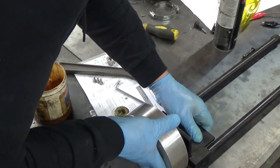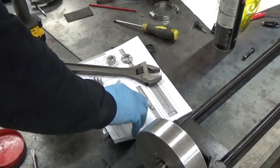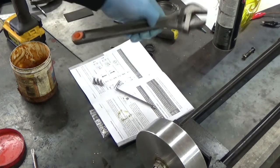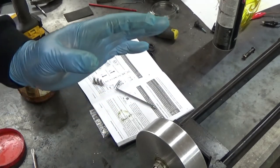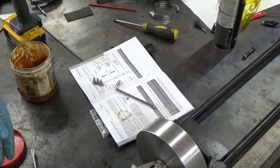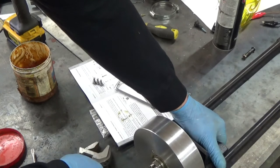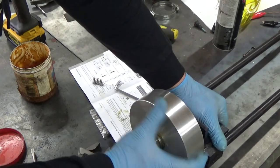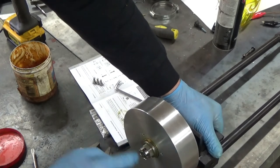I made this shaft so I know what it can do. The other bearing is pre-packed. Buying a greasing machine and then going through the painstaking task of keeping it clean is beyond it. Usually I use a pair of channel lock pliers to adjust these, but today I'll use a pair of crescent wrenches. What you do is tighten the bearing up until it nips — you can feel the taper come together, and when it's tight there's nothing left. Then you spin your wheel, which evacuates any excessive grease. You can feel it eventually getting a bit easier and you can see it injecting the grease.